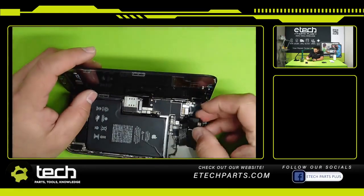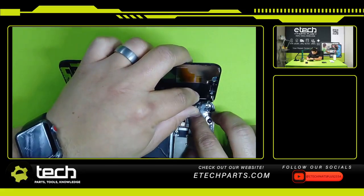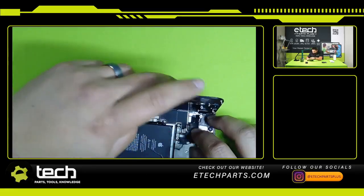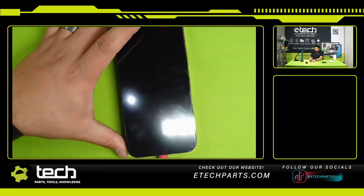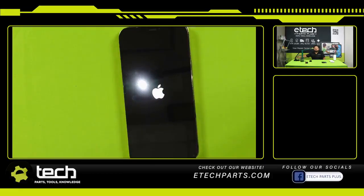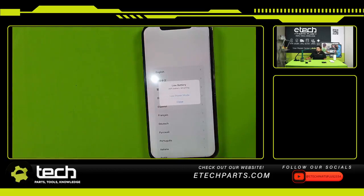To resolve this one, just like with the iPhone 12, I'm going to disconnect my battery. I don't have to disconnect my screen necessarily as long as there wasn't an issue with the connection. I'm going to connect my sensor flex cable, connect my battery, and plug it back into the charger. We'll notice this time that after the Apple logo, it'll actually boot up into the phone. It's actually working now, and there was nothing related to the screen that caused that — it was just that sensor flex cable.